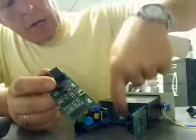Inside your meter, this will all just slide out if you wanted it to. This is the actual meter itself, but just leave it in the case. If you want, you can slide it out so you can see better. Your 485 card goes right here — these two pieces are to this side, with this being the top. These go to the right side. This is your connector, and it just fits right into that connector. You just slide it on the pins. Now you've got your RS-485 card installed.